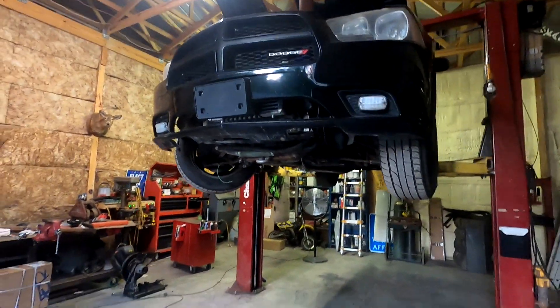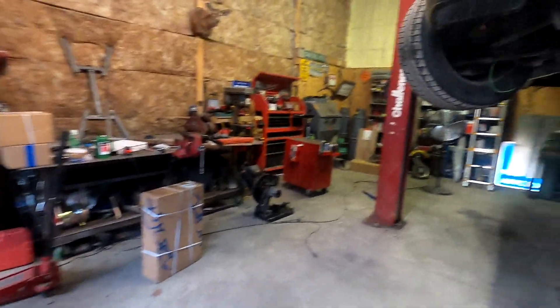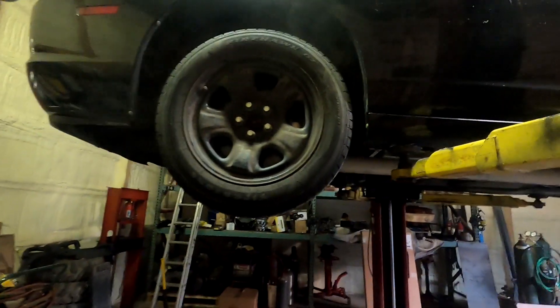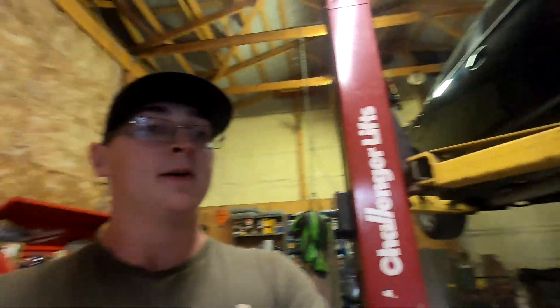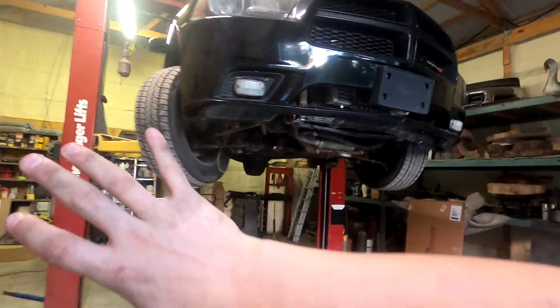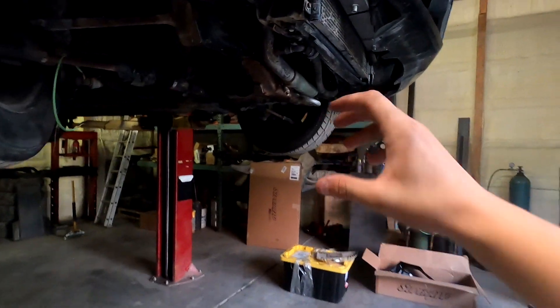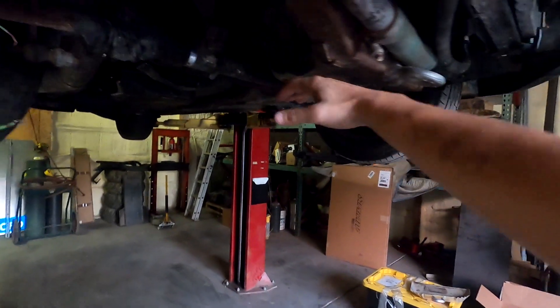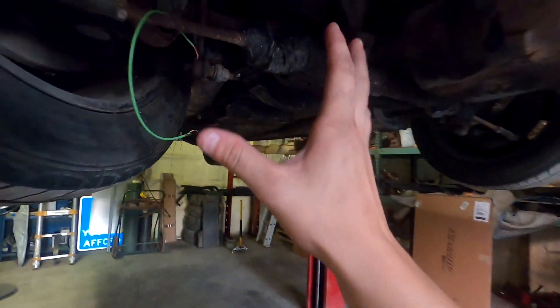I ordered rear shocks as well, however we have a whole Hellcat rear end going in here. Those springs are supposed to be about 600 pounds so they'll be about the same, but the Hellcat ones have automatic dampening — you have to hook them up to the car and we won't be able to do that, so I want to use what we have. In today's video all we're working on is getting this thing drivable. Next video we'll get rid of all this, bring everything up higher, get her aligned, get some tires, maybe some wheels — we're getting there.